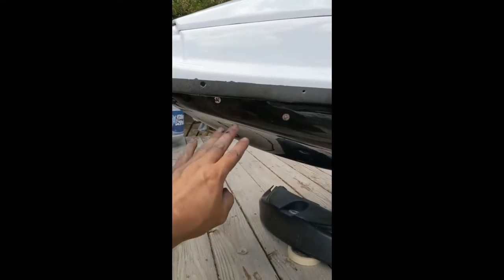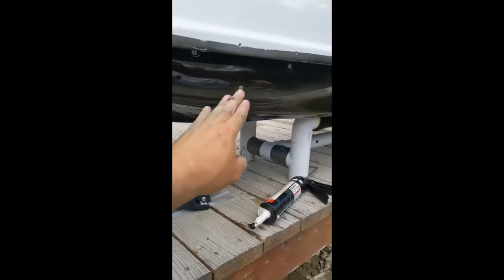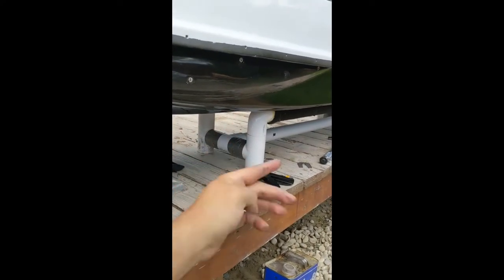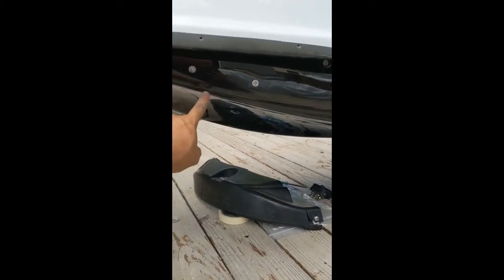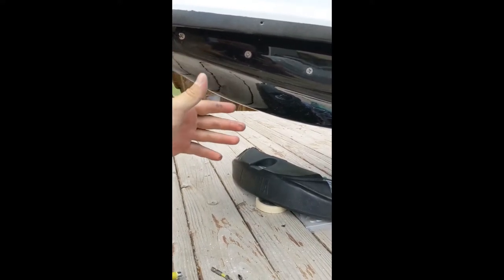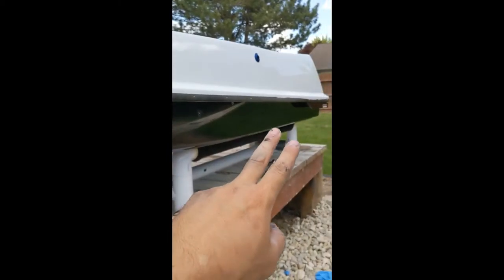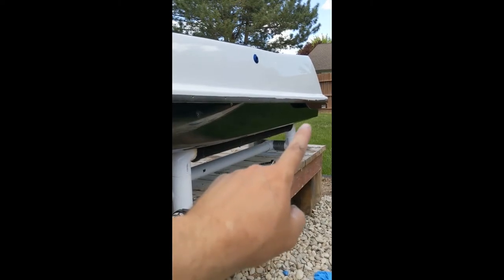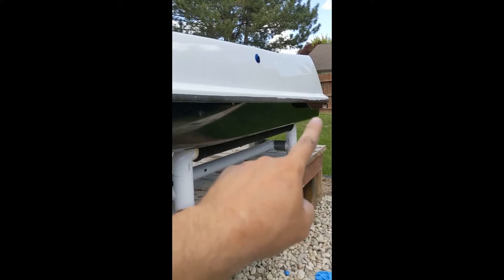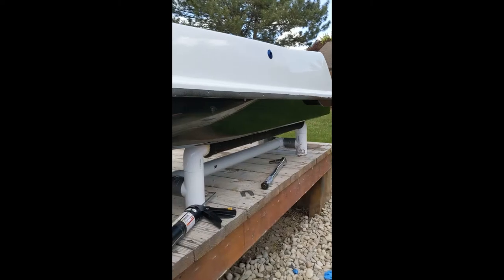And from what I've noticed, I've read a lot of forums, you should be putting the sponson as far forward as possible, and the rear as high up as you can. You want a very small lip here. You don't want it flush. If you have a little small lip in this area, it's just a lot better to grab. For the Superjet, a lot of pros that do buoy races say to do anywhere from 35.5 to 36 inches forward to the very tip from the very rear.